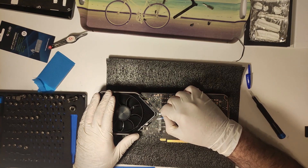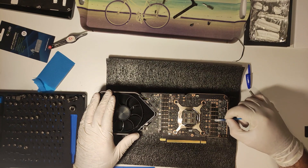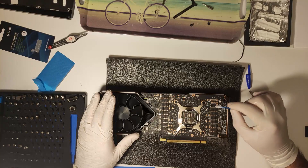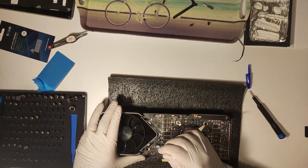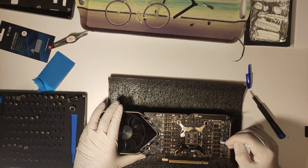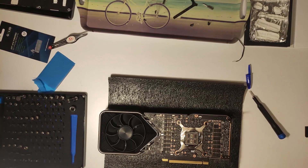I haven't spotted this testing step in any of the other guides, and I'm a bit confused as to why — especially considering the plethora of people who had improper contact after first reassembly. Using the 2mm thermal pads might give you great contact between the memory modules and the cooler, but there is a possibility of hotspots on the GPU die itself. Going by the number of people complaining about this online, a good chunk of owners who attempted this mod have had to adjust the pads to deal with those hotspots.